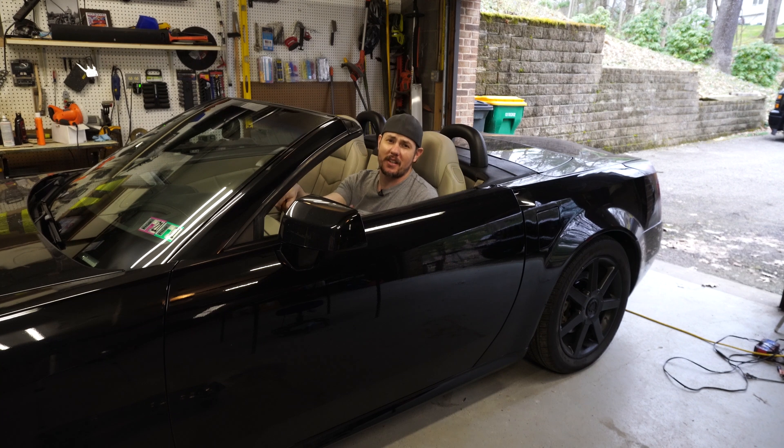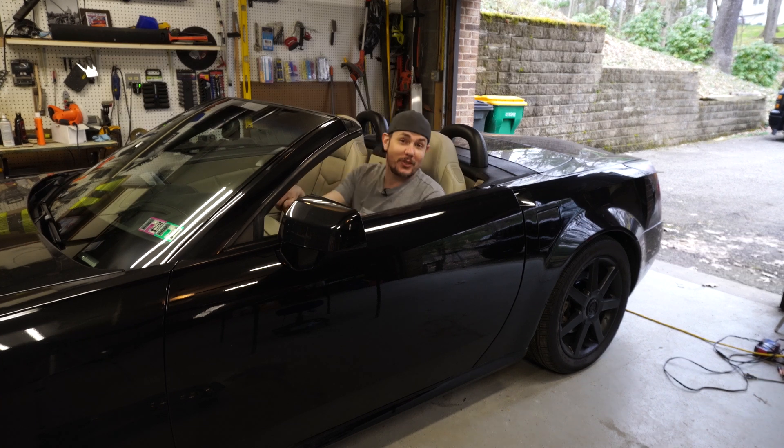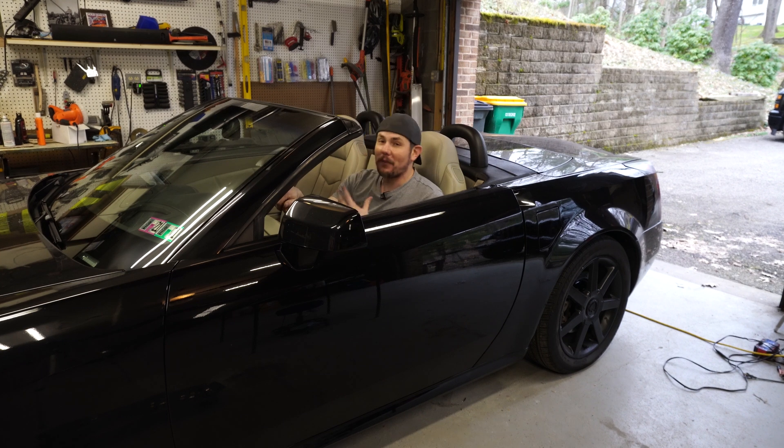It was causing some other issues with some of the CAN bus sniffing commands I was doing. So I thought, maybe I should just try the actual TCM. Literally, I moved my test setup over here, stuck it in the floorboard of the car, plugged it into the OBD2 port — and everything worked. I thought to myself, well, that was simple. Why wouldn't I just put this thing in as a dummy? So I took the test setup, put it in the back hatch in the cubby hole where the aftermarket TCM is, and just wired power and ground with the solenoid set to park — like I showed you on the bench — then tied it into the existing CAN bus. Lo and behold, we have convertible mode again. Hopefully you've gleaned some information out of this, and you can see that at the end of the day, sometimes you just have to get creative to solve a problem. For no more than that thing weighs, it's just easier to throw it in the little storage cubby and be done with it.